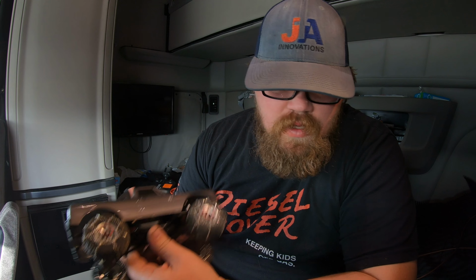The other thing we've done, we swapped out the motor. The stock motor did not last very long, so we just put the Hot Racing motor with their adapter plate in there. You have to take out one pillar post on your battery tray. That's not a big deal. It's lasted the whole 2 years that I've had this truck without any issues.